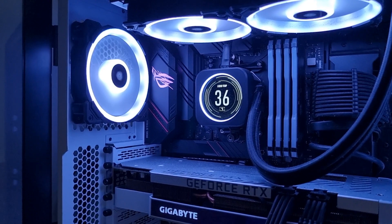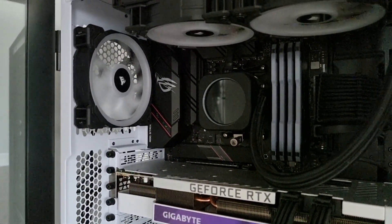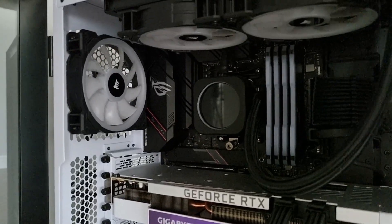All you need to do then is shut your PC down, and hopefully the lights will go off for you as shown on screen. So that's it — it's just one of those things that might catch people out thinking that going into the BIOS and changing those settings would work, but nothing works. It's just a case of getting into the Armory Crate software and ticking that little option, and hopefully it all works out for you.